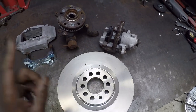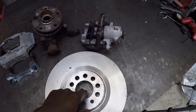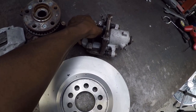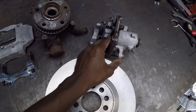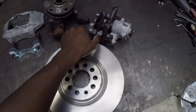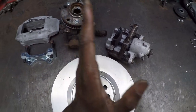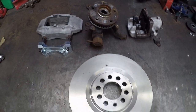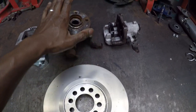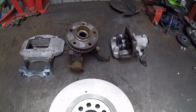These 4Motion rear calipers are meant to take a disc which is 256mm and 21mm thick. After measuring, the actual space available is more like 25mm, so they're fine to go over this 23mm disc. I'll probably shave a little bit off each edge just to give me a bit of clearance in case of any runout on the disc. I'll put the disc onto the hub and show you how it all mounts up.